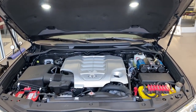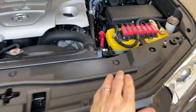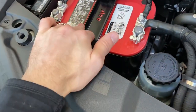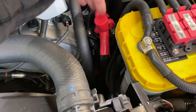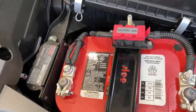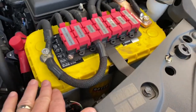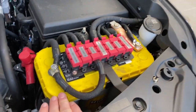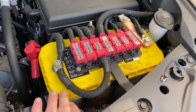What we've done is we've actually relocated the crank battery from your typical location on the right side and moved it over here. We're using this Lee auxiliary battery tray — the Group 35 auxiliary battery tray — so everything is rewired directly to the left side for your cranking. The reason for doing this is because you have a physically larger spot on the right side to put a nice big auxiliary battery.